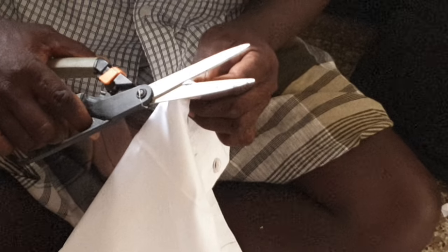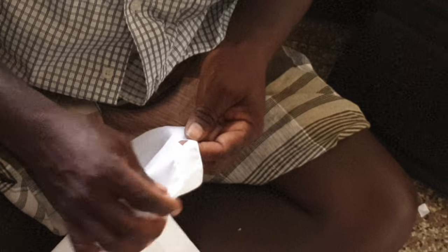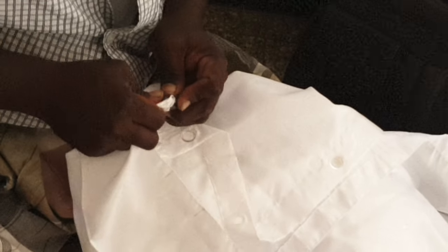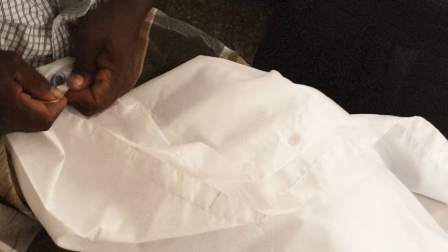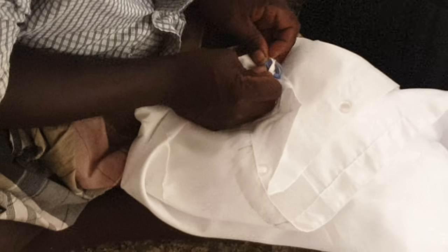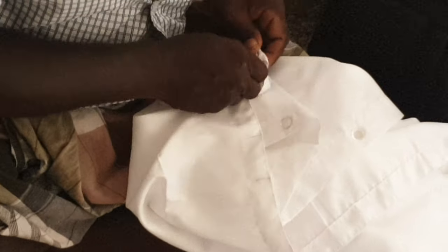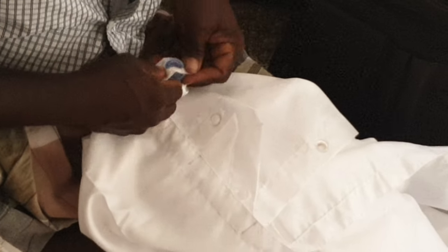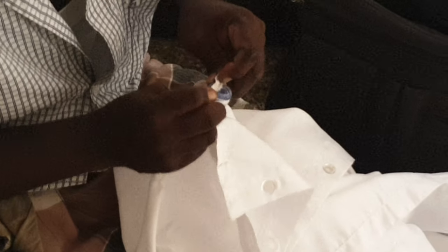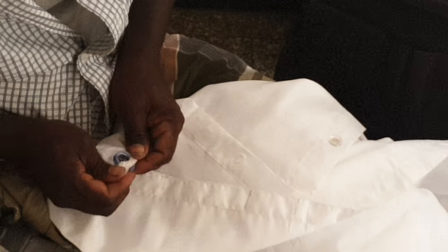The grommet is placed into this hole. If needed, the hole can be enlarged slightly. Once it is sufficient, the grommet is passed through the hole and with some perseverance it will emerge from the other side. A little bit of stretching of the cloth over the edges of the grommet may be required, as you can see here. With a final stretch of the cloth, it will seat over the central part of the grommet. A screwdriver tip can be used if needed to push the cloth over the edges of the grommet.